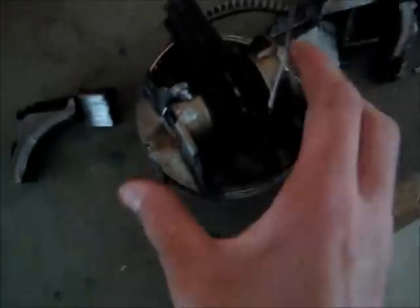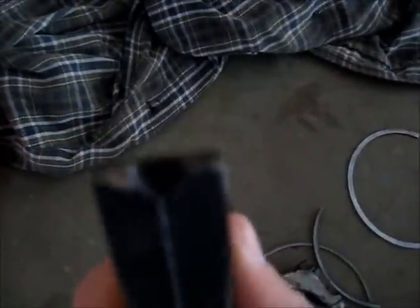But the engine block had a bit of damage to it. The cylinder piston ended up cockeyed in the cylinder like that, and damaged the cylinder wall. It did some damage to the block, knocked the conrod cap back and smashed the oil pickup off the bolts. And then the engine had no oil pressure. Done all sorts of nasty stuff to the engine. It had a big dent in the sump where this half went through. You can see some part of it. Where it hit, I think it's this half here. But it scunned the sump. Just kicked a hole in it.